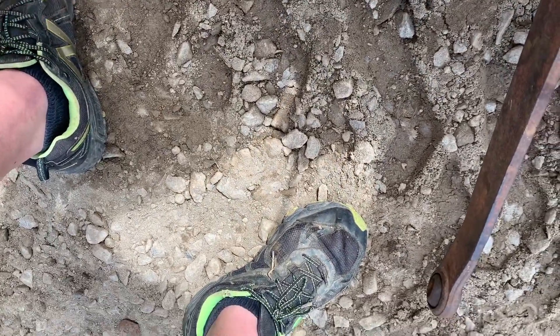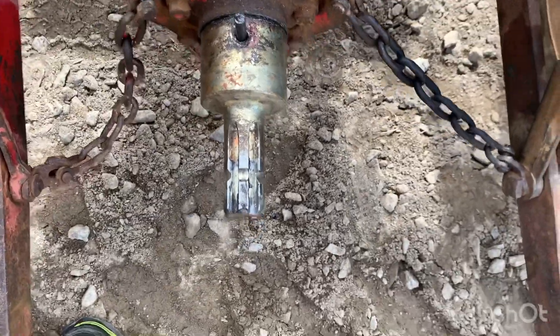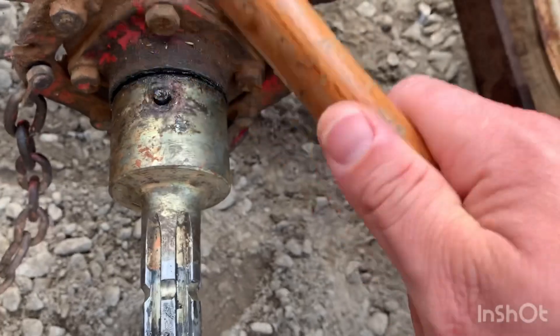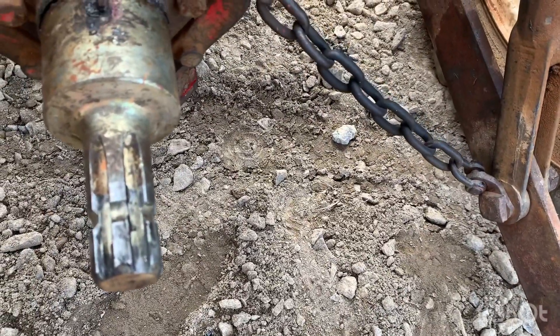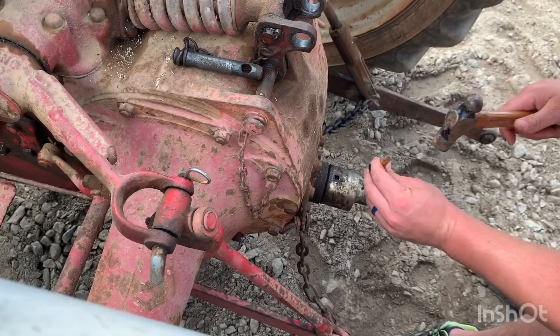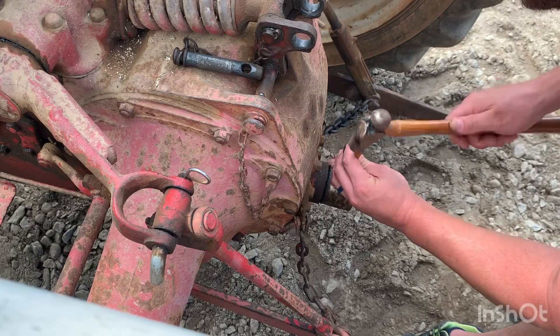Now I'm going to show you how to install it. From the start, you want to make sure you've got some grease in there on your splines. Then you're going to lightly tap it - it's real light and it'll kind of self line up, and you can feel it'll go right into that hole. Now what we've got to do is get our punch and keep hitting it just a little bit. We've got to countersink the roll pin - just sink it in there about a quarter of an inch. You'll know when you're deep enough because it will not turn until you've got that roll pin in deep enough.